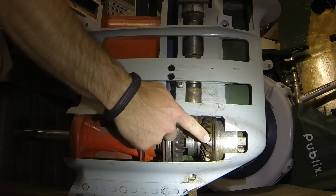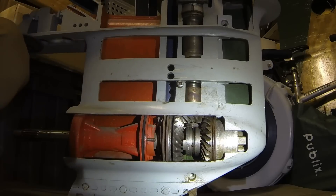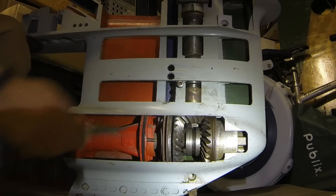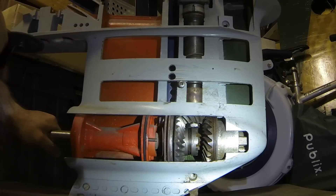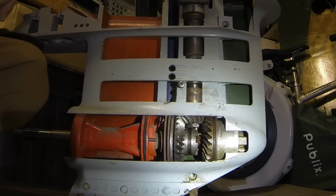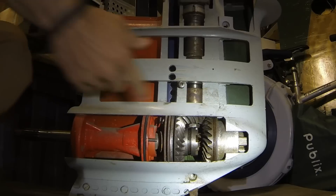The dog is engaged one-to-one with the forward ring gear — that's your forward gear. To stop the propeller, you go back to neutral and push the dog out of forward gear. For reverse, you push down on the shift rod and slide the dog into the reverse ring gear. Now the dog clutch is in the reverse ring gear, and as the drive shaft rotates it turns the reverse ring gear, spinning the prop shaft in the opposite direction.